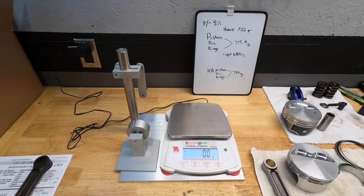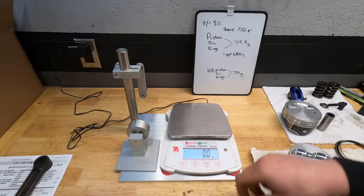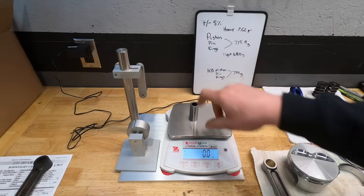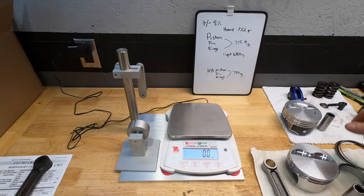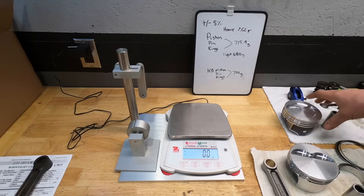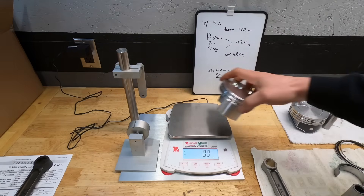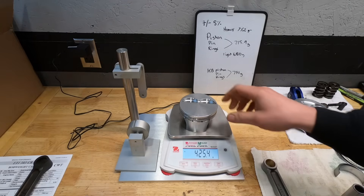So it's not a simple yes or no — it really depends on the parts you're using. Make sure when you're looking at pistons you include the pins, because pins make a big difference. Look at that — a stock pin is 160 grams. Look at this aftermarket one — 108 grams. Big difference just in pins. And just in the pistons alone: a hypereutectic is 540 grams, a forged is 425 grams. So when comparing assemblies, always weigh piston, rings, and pin together.